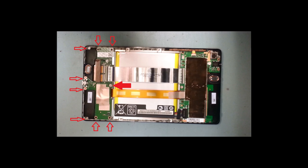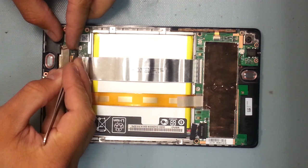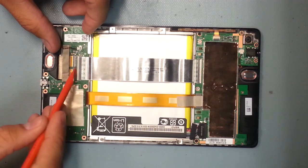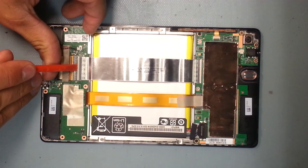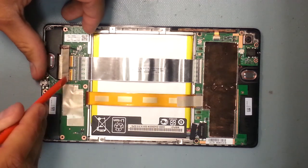Pull them all out and set them in a place where you'll remember where they go. We're going to disconnect the speaker, which is kind of like a wall outlet plug — you just unconnect it. These little ribbon cables have a little flip latch. I disconnected the two on the smaller side and then it has the big flip latch for the silver ribbon cable. I'm starting on one end and prying it up all the way across — and you saw it just flip up right there.